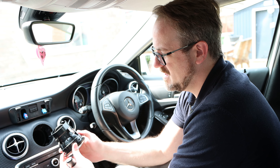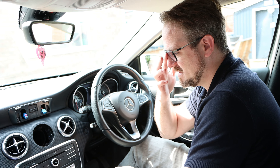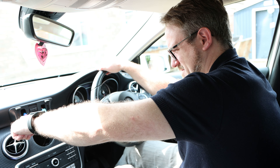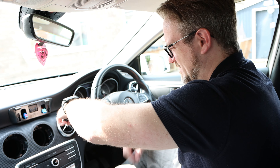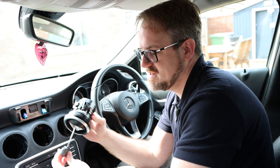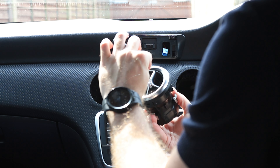One of the metal clips has come off and disappeared inside the dashboard, so I'm going to have to find that after I've removed these other two vents. What I found is that if we twist this 45 degrees and then pull, it will come out — that's the easiest way to actually get these vents out. As it happens, I don't need to take the center vent out; I can see the two Torx 20 screws in there, so I'm going to take them out now.